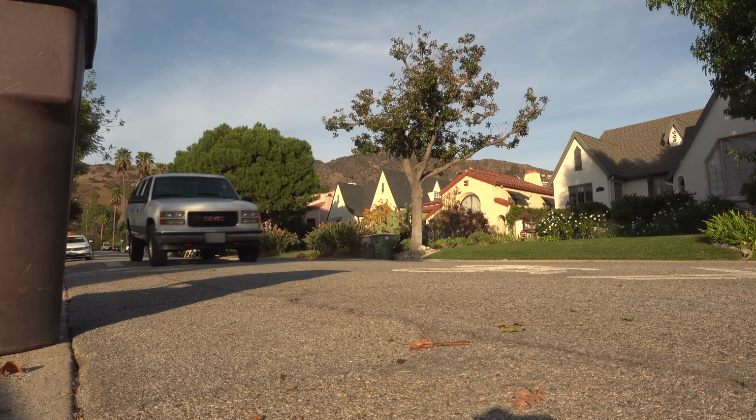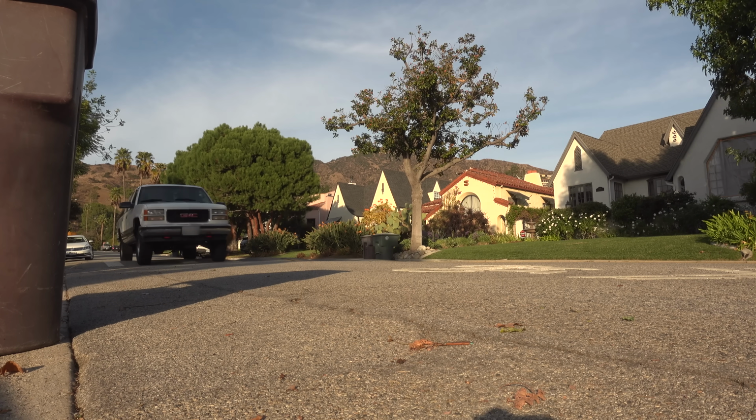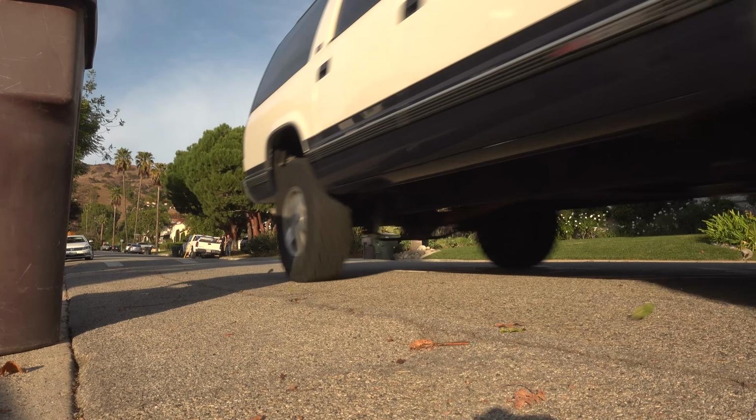Basically, when I would hit a bump or a speed bump, the suspension would rebound so hard and fast that it would actually hit the droop stops on the way back down. This in turn would make my tires bounce off of the ground. Even on wavy stretches of freeway, where I'm doing 65, 70 miles an hour, I could actually feel the front tires coming off of the ground, and that's not safe at all.